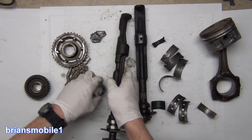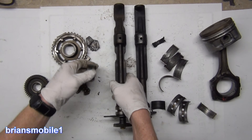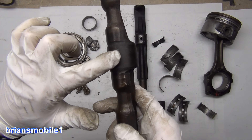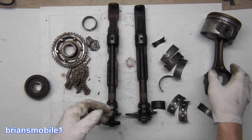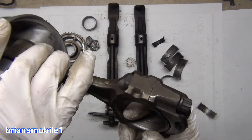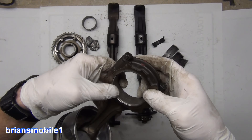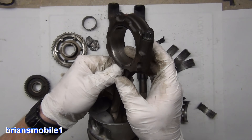It fell off the end — it was on here and just kind of migrated off. When it did that, it came off at about cylinder four or three and just munched the heck out of it with the piston skirt. With the bearing gone you can see where it got smeared because it got too hot. I think some of the oil journals got covered over. On this piston it's supposed to have a squirter right here that squirts the cylinder wall — and that's just totally blocked off with metal. This is a split bearing — one of them ran over the other, got thin, and just kind of overlapped. Once that happens you're kind of screwed.